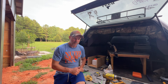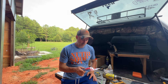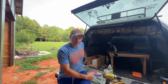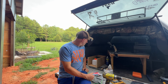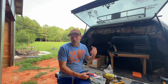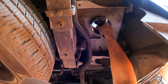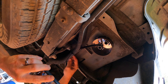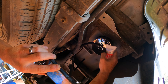I'm going to go ahead and seal around that turret. I've got some Permatex here — it's like a muffler sealer that can resist heat. The exhaust for this heater is under the truck; it's going to stick out the side, but the wind could blow it back up or whatever. This will seal all that to keep any of that from seeping back up into the truck. Probably wouldn't be a problem even if I didn't put this, but it's just added security. And it also seals it off to keep any moisture, bugs, or whatever from coming up in the little bitty cracks between that turret and the bed of the truck. That zip tie will hold that out of the way, and I'm going to take this Permatex and go all the way around the edge of this stuff.